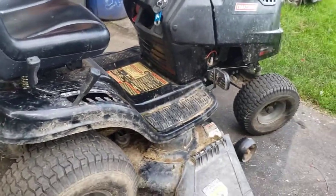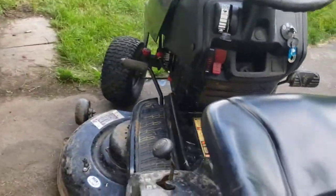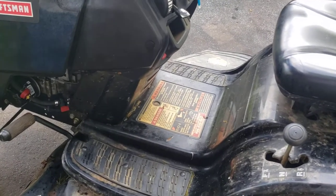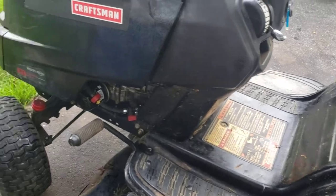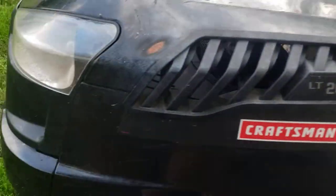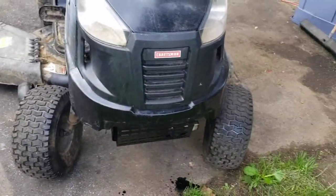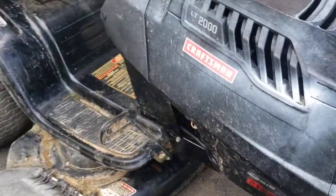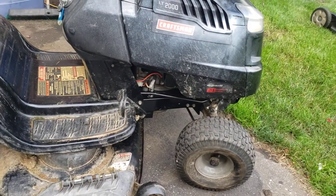The gentleman got lucky that it didn't crack, I guess. But I still suspect that there probably is already some engine damage in this unit, because there's a little bit of clatter right here on the valve train, which is probably push rod related at that point.